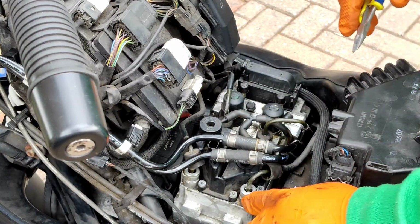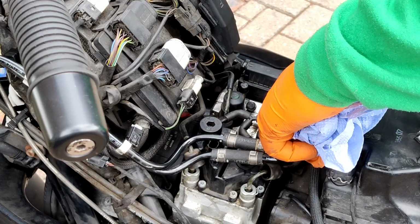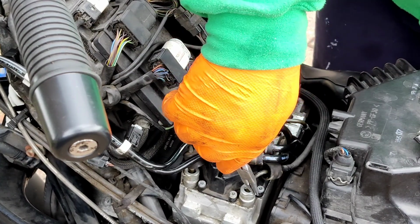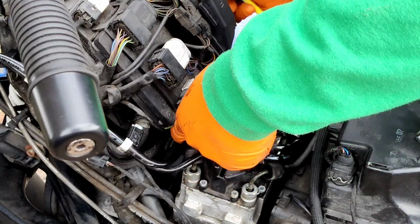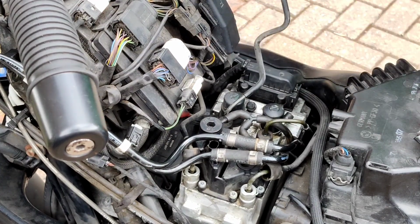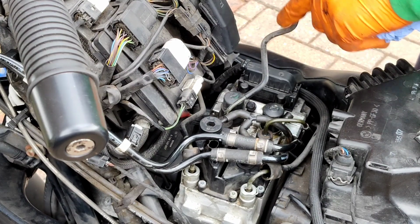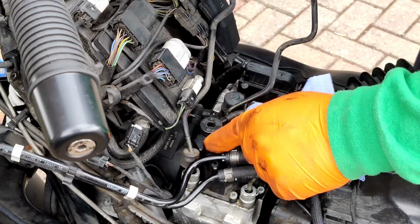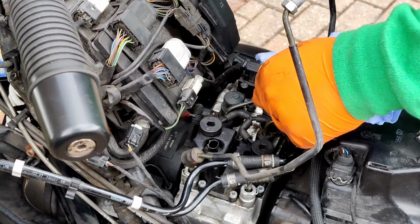So this is the old back circuit out to the back wheel. This is front from the pedal. So this goes and comes out here. So that's a bit of hose that I want to pull out. This is from the front. So this came from the lever. So the lever pushed and the fluid went in there. And this then pumped it back out to the caliper. So that came in from the lever, that went out to the caliper. So they're two separate circuits.